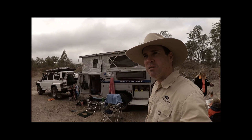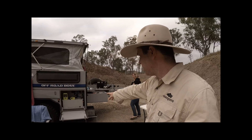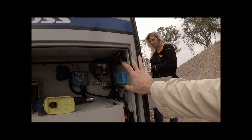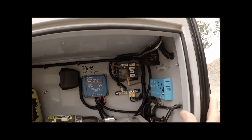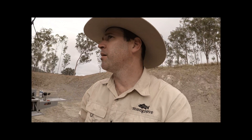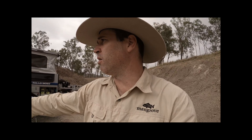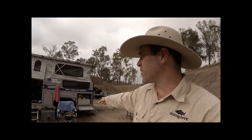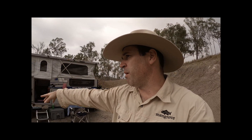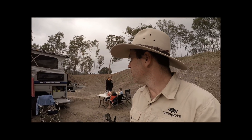Today's day seven. Yesterday we had lots of sunshine while driving — it was charging at 14 volts and I think it's fully charged. It's sitting again on 13.3 volts. It was getting heaps of solar yesterday. It lasted a whole week in the shade there, running the fridge for a couple of days, and saved our bacon. It's probably going to open up a few doors with what we can do electronically. We can run the fridge a lot more off the trailer — I know it'll charge very well just off the 160 watt panel.